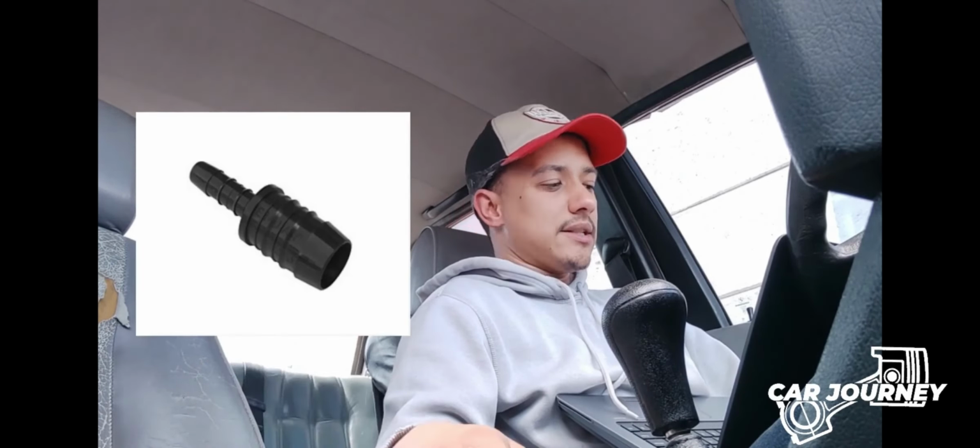Okay, so under the bottom of here, where these fuel lines are, I'm going to move the fuel filter to the back over there, and then put the high pressure pump here, because there's already a high pressure line and filtered fuel only feeding to the pump. It just makes sense, because then there's ground lines there as well, and battery positives to connect up.